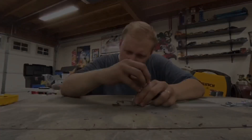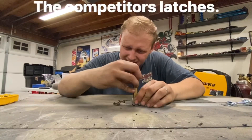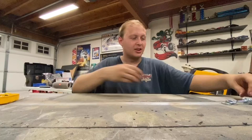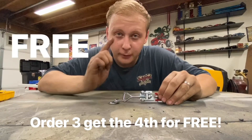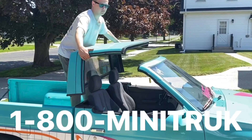Are you tired of these old Radical Top latches? These new ones are nice — thick material, they're going to be great in your truck. But seriously, now that we've got our top in place, we're inside locating where our latches go. We'll start with our roof — about right here is where we want to put it. Get it roughly in the place you want, take a marker and mark your spot, then we'll use some steel rivets to rivet it in.